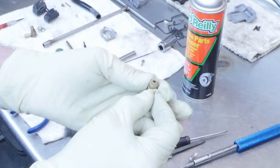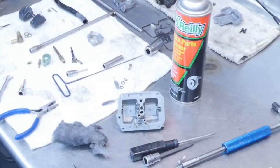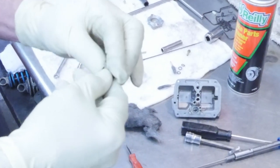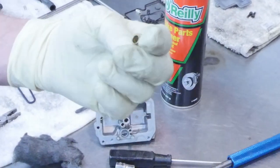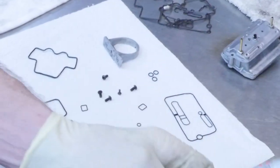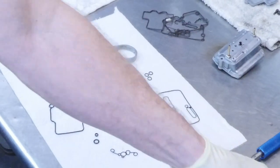I'll reinstall the screen — it goes on the very bottom. Now for these I have extra O-rings. I don't know which ones I use, so I'll get one ahead of time and put it on there. It should come in a carb kit, all this stuff, but if it doesn't you can restore it. Clean inside, new O-ring on there — I could reuse that one no problem if I had to. Put a very light coating of dielectric grease on all the new O-rings. No excess — very, very light. That'll help them stick when you're going to put them back in.